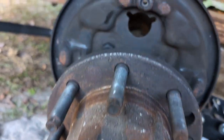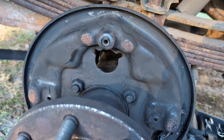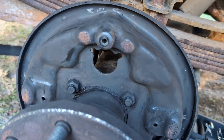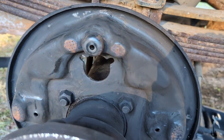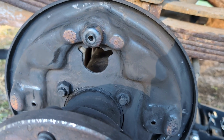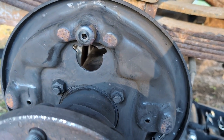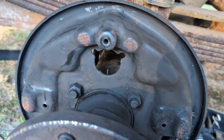Yay. All right, let me go ahead and get this new cylinder in there. It's a pair of 1/2 bolts, and then I'll go ahead and get the brake line in, and then I will pop the bleeder, and that will let the air get out of the cylinder and also let us do squishy things so we can get the new shoes on without issue.